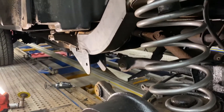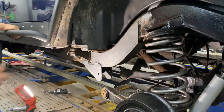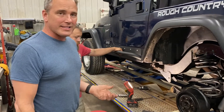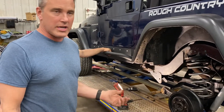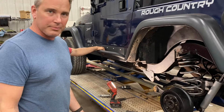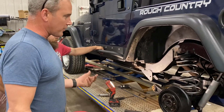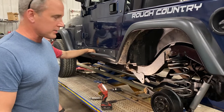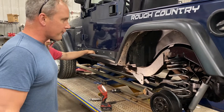If you've got one of these vehicles and you're not sure, look down between the wheel wells. If you've got a bunch of holes, rot, and rust, it's probably not safe. If you got rear-ended in this Jeep, the frame would fold right up and potentially kill you. Same with the front end — if you're off-roading and jump it, this frame is just going to come right apart on you. So this repair will make it a lot stronger and get a few more years for this guy.